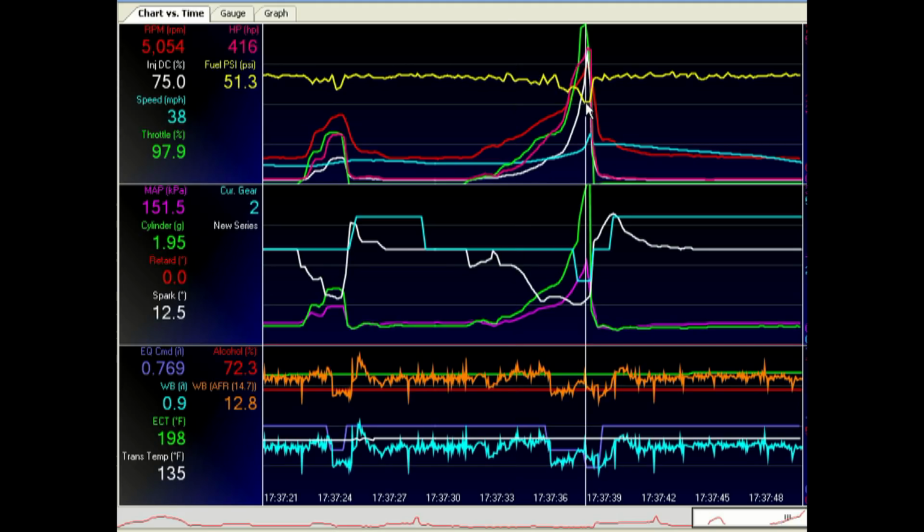So basically what's happening, this dropped to 51 from like 64, flickering around 60. So let's call it 60 down to 50. So boost pressure's coming up and fuel pressure's still dropping. That's without the fuel pressure regulator hooked up to the vacuum line. So when it is hooked up, I think it's just masking this issue. It's actually raising, it's just compensating for the loss in pressure. That's why it looks like it's flatlining. It looks like it's just steady, but it's not steady. I am losing pressure, and the pressure regulator is working.